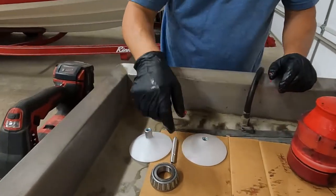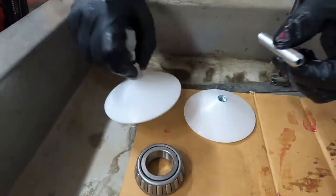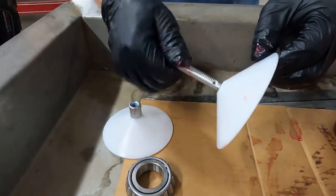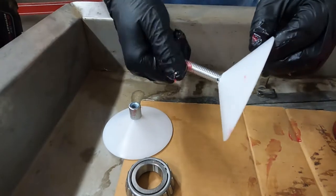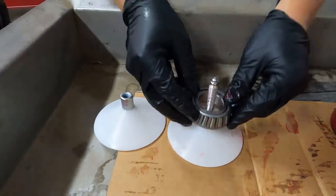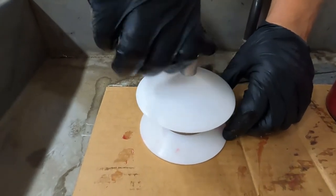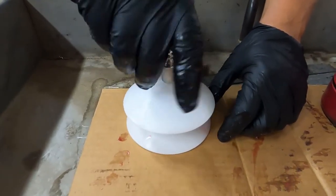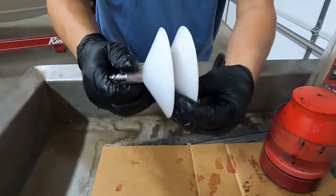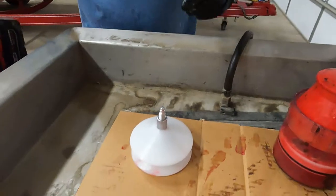This is another packer that I've used in the past. I will tell you, it's not my favorite bearing packer by any means. It's going to come three pieces in the package — it's easy to assemble. This is your bottom portion. You'll screw that in with the greaser facing up, and you'll put the bearing in it with cone up in the same direction. Then attach the top piece and screw it down. You will have to get the bearing as straight in there as possible, and you will have to have a grease gun.